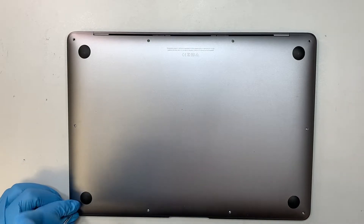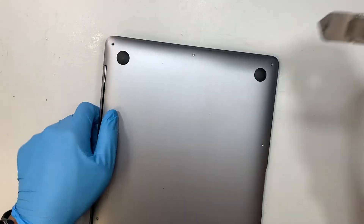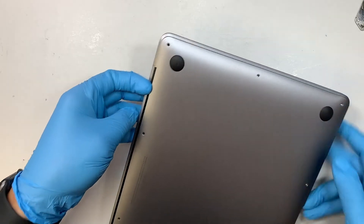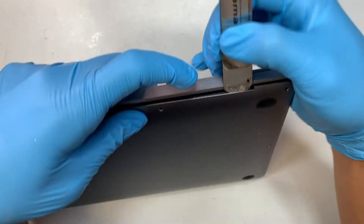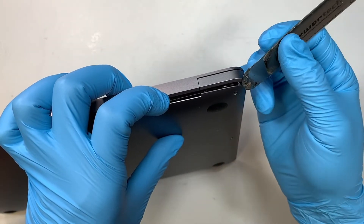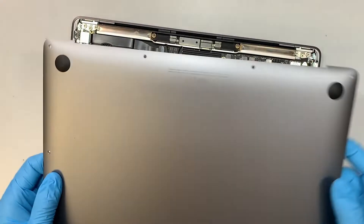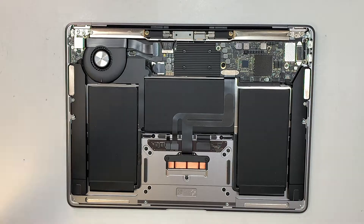You want to have them positioned on the table so you can remember to put them back accordingly. Once you have removed all the screws, the next step is to pry open the back cover. I like to get a metal prying tool and use it to go in between the back cover at the corner. Use your fingernail to pop it open — that's how you remove the entire back plate, which simply lifts off the computer.